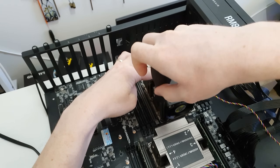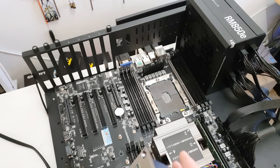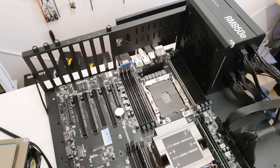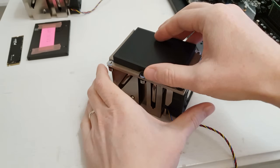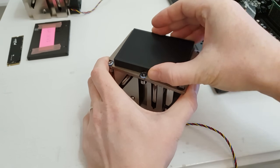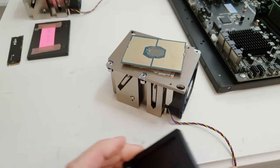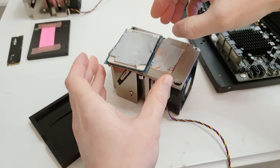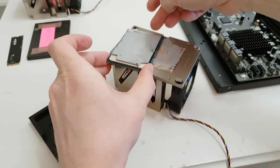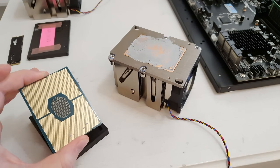Installing the CPU may feel awkward because the CPU is not secured in the socket when you screw the cooler on top. But removing the CPU is the next-level challenge. If your thermal paste is not sticky enough, while removing the cooler it will lift up the CPU, and there is a risk it will drop into the socket. If the thermal paste is sticky enough, the CPU will stick to the cooler, and then you face the challenge of removing the CPU from the cooler. Even if you are experienced and prepared, the CPU may still snap from the cooler and you may get some damages. In my case I was lucky and didn't damage anything.